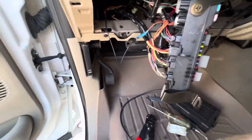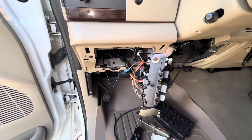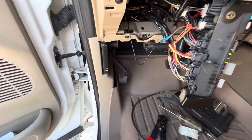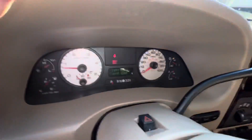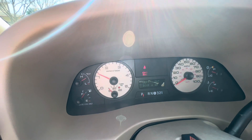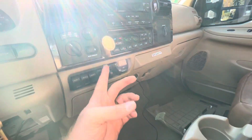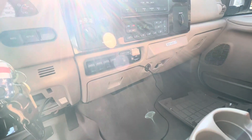In order for this to work, just turn the truck on. You're going to let it run for a minute — the e-brake has to be on for this. So once you let it sit there for a second, you can see I'll flip my upfitter 4 switch. And boom, just like that — high idle. Easy as that.